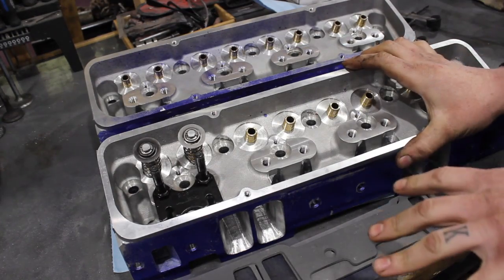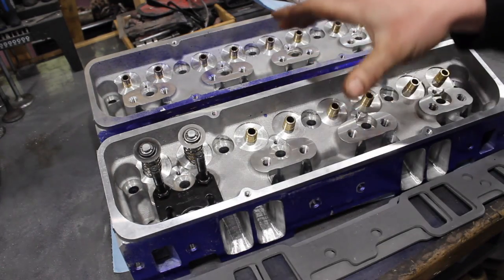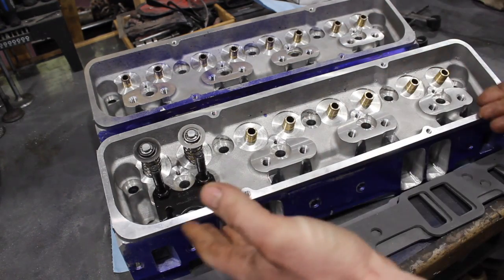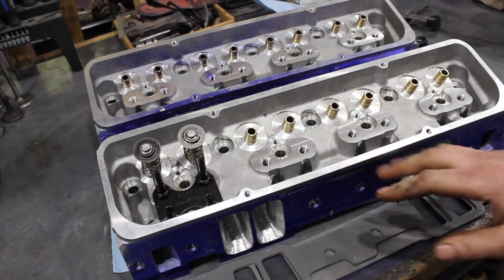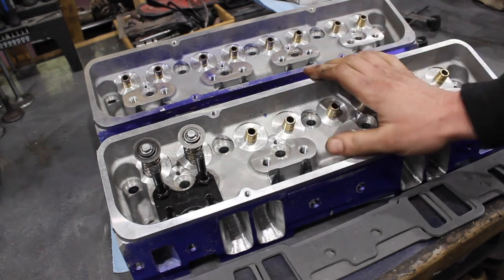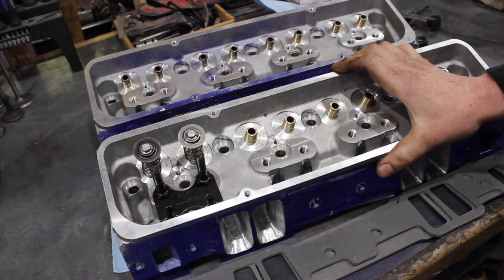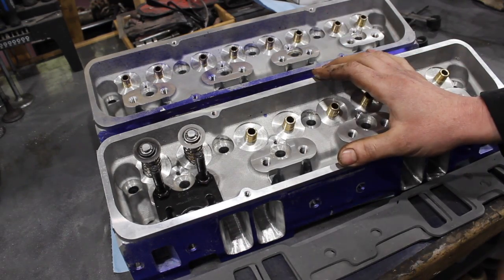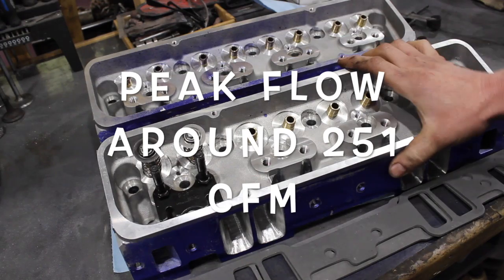So these are the DNA performance heads, better known as maybe Assault Racing heads. Some guys call them eBay aluminum heads. The well-known brand name is the AFR Enforcers — they're basically the same heads as the AFR Enforcers, except the AFR heads have the 8mm stems, which I found makes very little change in flow increase. It's more of just to have a lighter valve train. For what they're advertised at as being 195, sometimes 200cc heads, considering how large the intake runner is, they're not really that impressive for flow.